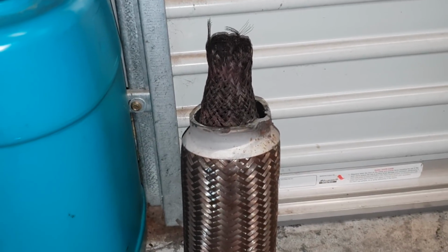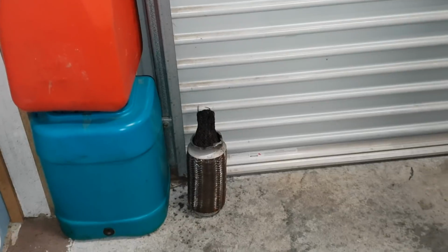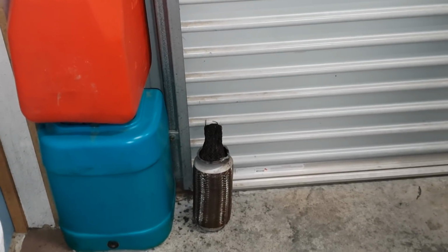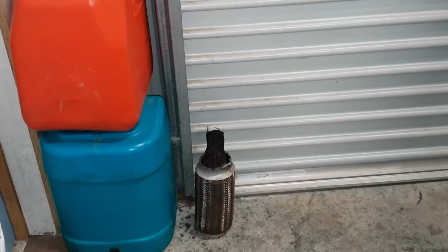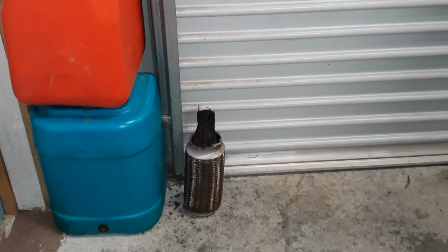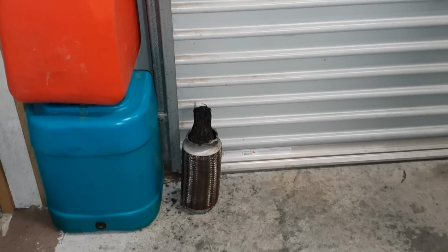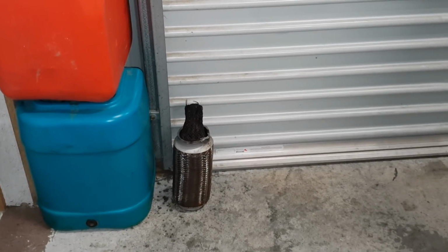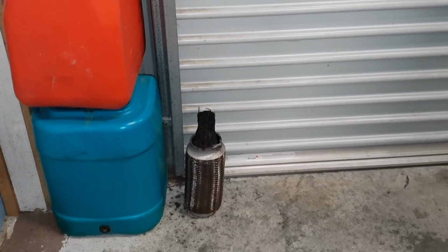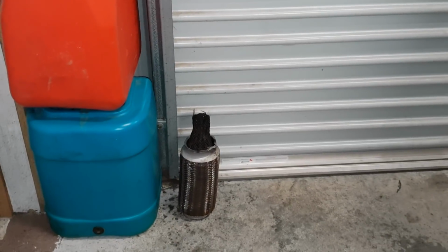You know what, guys? I've got to admit it, but I noticed the 355 the other weekend there. When it ramped up in boost, it was incredible, but once it got up around 4,500, 5,000 revs, it felt like it was laying over. I wasn't sure what the go was. I had a look at the timing, I was checking air fuels, and I couldn't understand why it was laying over. It used to lay over a tiny little bit with the 308, but I thought that was the way it was. But I know from previous, like 12 months before, it used to really fly, get up in the top end and just go really crazy.